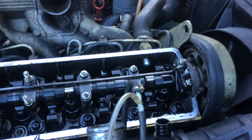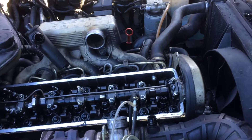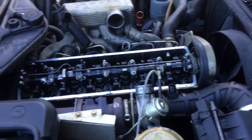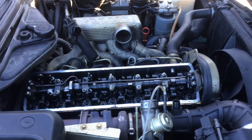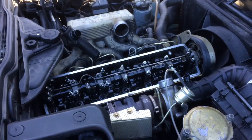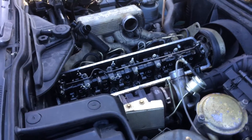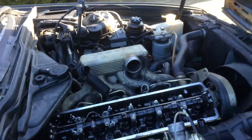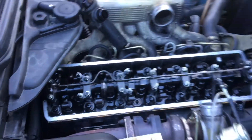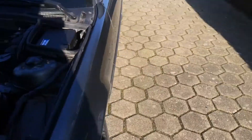I usually go from the front to the back. To rotate the engine, I just put it in fifth gear and roll the car forward and back a little bit. So I'm going to adjust all 12 valves and then fire the car up to hear if it still does the clackety-clack sound. I have readjusted all the valves — especially one was really loose, which I didn't notice yesterday. Now I'm going to fire the car up as is, just to see if we still have the knocking. If not, I'm going to reassemble it with the vacuum pump as well.